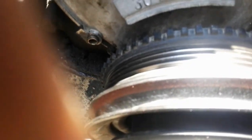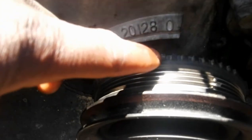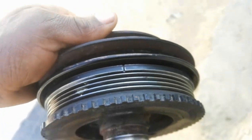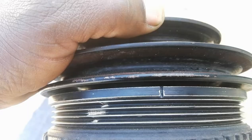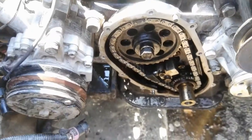Because there's not enough space, you can't see the mark I'm talking about, so I'm going to take out the pulley and show you the mark when the pulley is in my hand. This is the pulley — this is the mark I was referring to; it's supposed to be in line with the zero. On this car it was making noise on the chain side, so we're going to remove the chain and then put in a new chain and new tensioner.